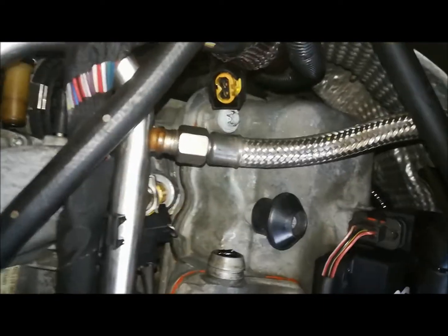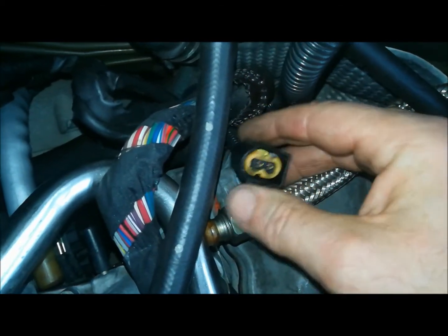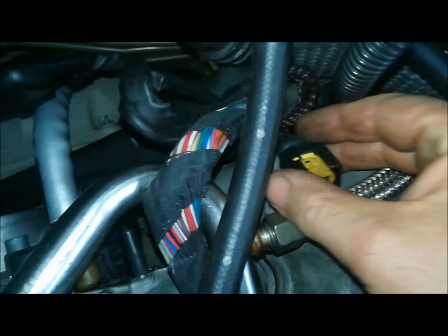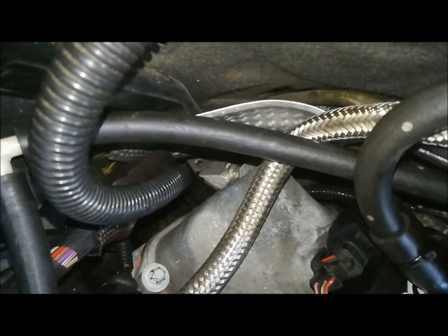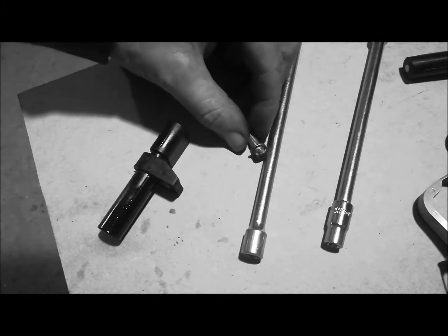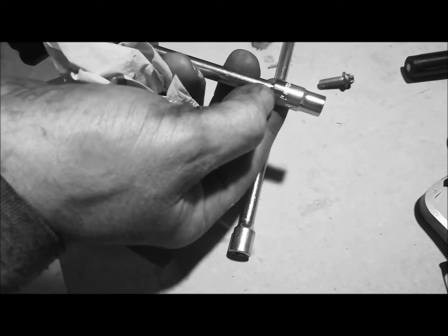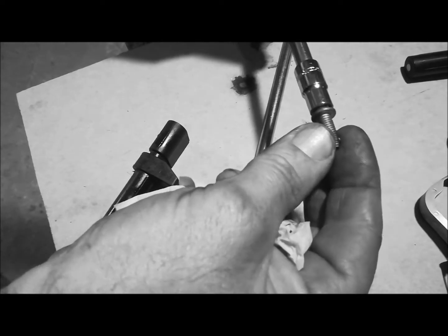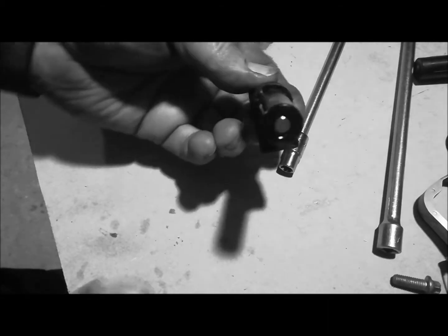I am honestly sitting on top of the motor in order to get my hand down there and unplug that. There's the plug — it's got a clip on this side and you've got to squeeze to get it off. It looks like it may be a little bit broken on this side. There is a screw hidden down on one side — it's a hell of a mission to get out. It's a number nine socket — needed that with a universal and two extensions.